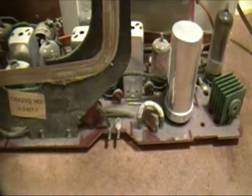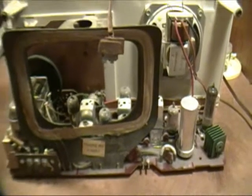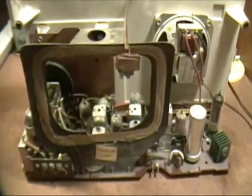It's made for a Sunbeam Mixmaster and things like that. If you look for a five-sixteenths-inch appliance cord, you'll find cords that will fit those pins with that spacing. In other words, they're the equivalent of the cheater cords electrically, but physically they're a little bit different. So I think the first thing to do is to get this chassis kind of cleaned up.